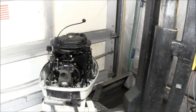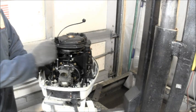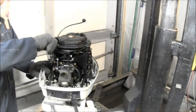The first thing I'm going to do, I think, is just go out and get a recoil start. Well, first, I'll take that back. I'm going to do a compression test and a spark check on it. And if that checks out, then I'm going to go get a recoil start and put on here, and we'll just see if it fires up. There's supposed to be some little tin cup things that go over top of these. They're all there. I got those tin cups.